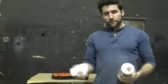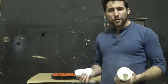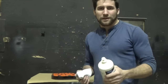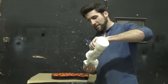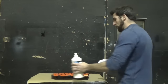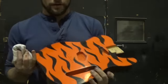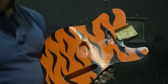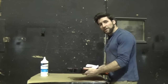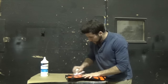I'm going to use it on just a lint-free cloth. Don't use microfiber — it tends to leave scratches even though the entire purpose of it is to not leave scratches. You can use a foam pad; a foam polishing pad on a polisher would be ideal. But I'm assuming a lot of you don't have polishers. So what I'm going to do is take some polish on a cloth, spread it around the area I want to polish in a thin layer, and then rub it in as hard as I can. With a polisher you give it medium pressure because you're spinning, but by hand I can't move as quickly, so I need to press.